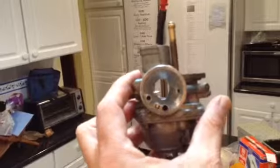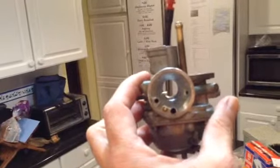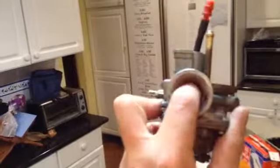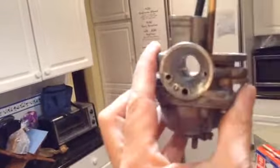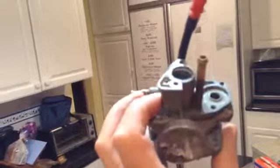I took about a millimeter. You have to keep the Venturi, which is the thinner part. So what I did was take at least a millimeter all around out of it. I started from the outside, took a millimeter from out here, and then took a millimeter from the inside. So all in all, I enlarged the whole thing, smoothed this down and took some out. I've got to hit it with some fine sandpaper, and then it'll be done. But I'll see how it works, and that's how I'll take you outside.